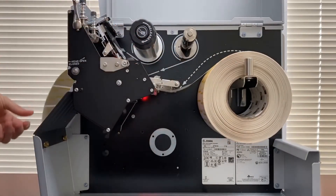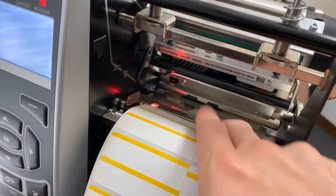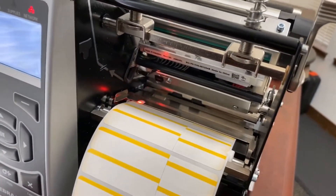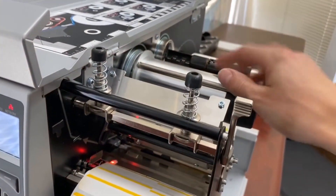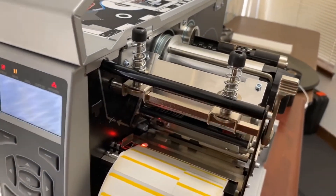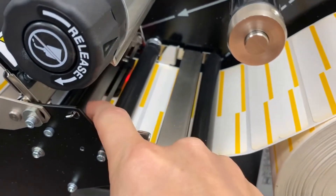You have your snap plate right here, and it uses a reflective surface to sense whether there is a ribbon installed. If you're using direct thermal printing you don't need to worry about the snap plate, but it comes standard so you always want to keep it in just in case you install a ribbon. If you do have a ribbon, you'll load it back here and the snap plate is required for the printer to detect the ribbon. The labels go underneath this roller right here, and they can get stuck right between this roller and the printhead.